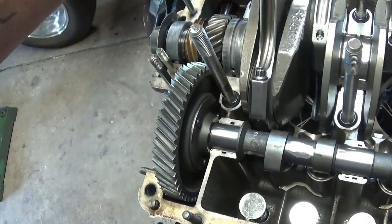My favorite all-around engine. I've been thinking about this a lot. Something that gives reliable horsepower and is easy to assemble, that you could have a lot of fun squirting around town, or you could take it on a long trip. To me, that engine would be the 2-liter. It's like a 78.4. Sometimes they sell them as a 78.8, so you don't have to worry about shims and where you're going to get higher compression from.